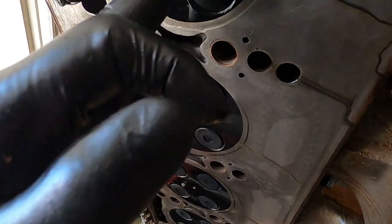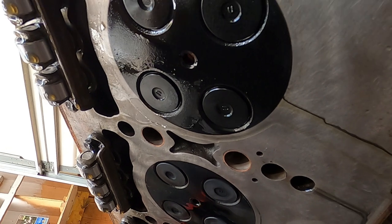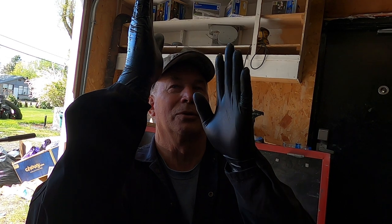This hole and that hole didn't work — that would have been two and six. Five wasn't far behind. We've got to find out if all the rods are the same length, because every time you size the big end of the rods it shortens the rod up a little bit. If you mix one that hasn't been done with one done about 27 times, you've got one that's pretty long and one that's pretty short. That's why when you've got a motor that runs okay, you save all the pieces out of it — you can't just arbitrarily go get some more parts. That is a very bad idea. So many guys think they can work on this — they throw anything into it. It runs when they're done, but it doesn't run very long.